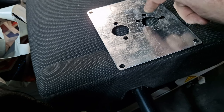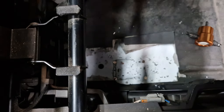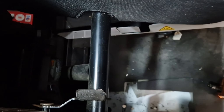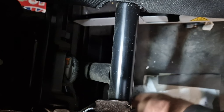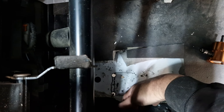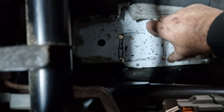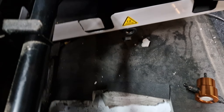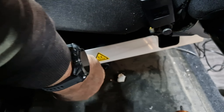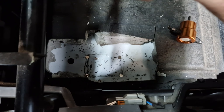Put the inlet, exhaust and fuel line in, lower it down and do everything from underneath. Looking from the top there's not much light here, but as a point of reference there are two seat bolts — basically about the same distance again to the left of that and in slightly. Another point of reference: there's a grommet, maybe an inch or two back from that. That's the 12-volt feed I'm using; not sure if that's on every Custom, but I'll go off that for the power for the pump. I'm going to cut that with the hole cutter now.